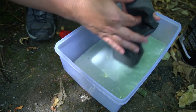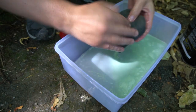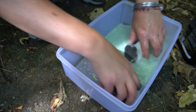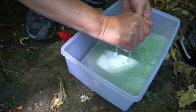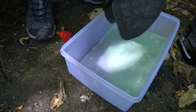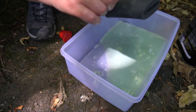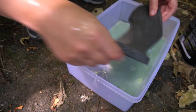So you've got to be pretty careful with foam filters. You're not supposed to wring them out. You're supposed to squeeze them. It's got hair on it. If they get rips or tears, all the dust and shit will go through the tear because it will have the highest pressure. Someone's hair stuck in it, maybe mine.